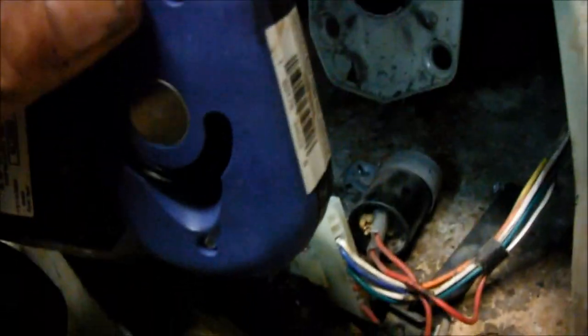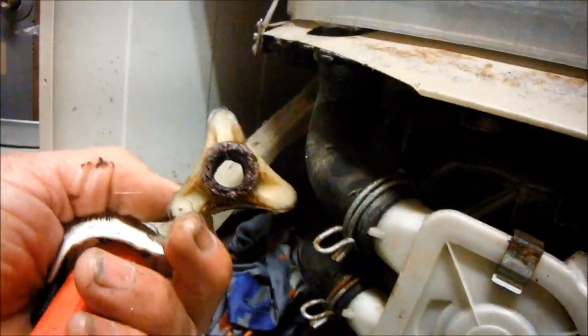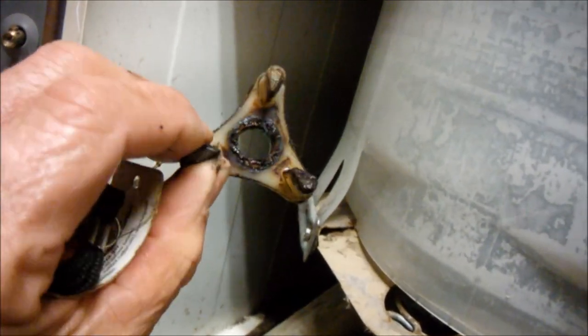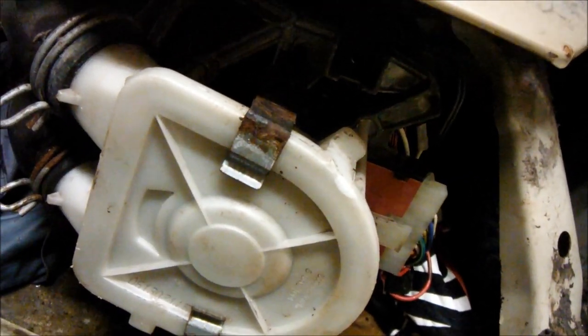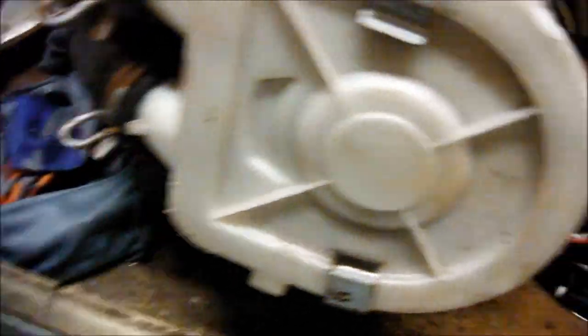A new water pump is needed too because it looks like it's been leaking — no puddles, but we've got a drip coming out already. So this one's going to be a bit of a job. I did have an extra motor. That's the steel-sleeved drive coupler — it rounds out the shaft on the motor and or the shaft on the transmission. If you're lucky, it rounds out the motor shaft; not so lucky, it rounds out the transmission shaft.